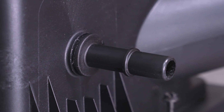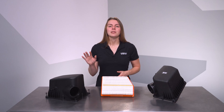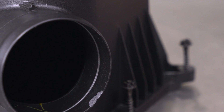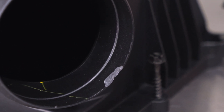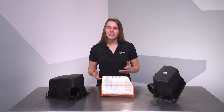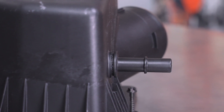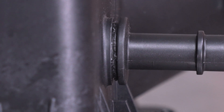There are a few contributing factors here. The first is the material itself — this plastic is unbelievably brittle. The product manager for this line accidentally broke one when just examining the part, and you can see the chip our video producer made in this one we ordered just for this video. It's never even been mounted to a car. The design leaves a little to be desired, too. The PCV fitting exits directly perpendicular to the lid wall, and the fitting is plastic that's been spin-welded in place, which is very weak.